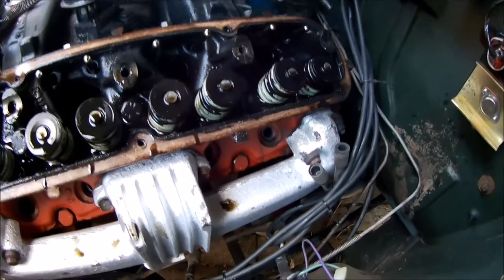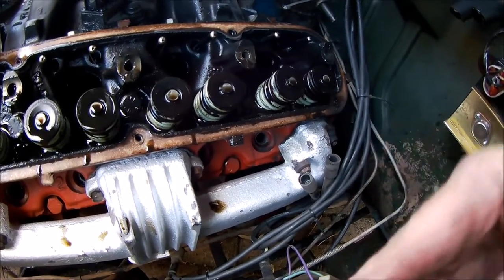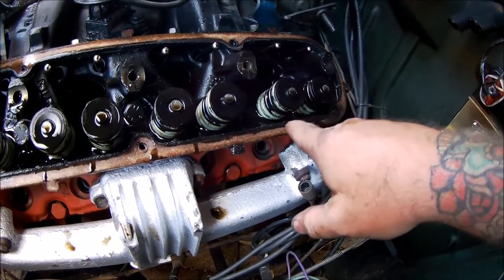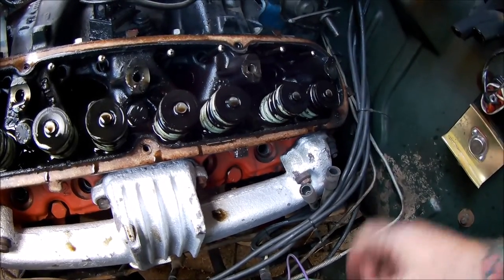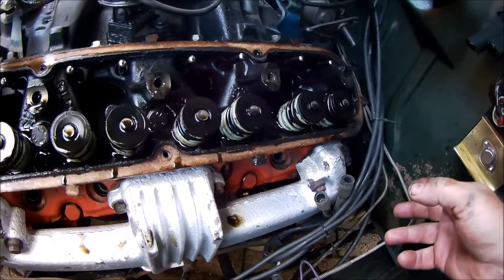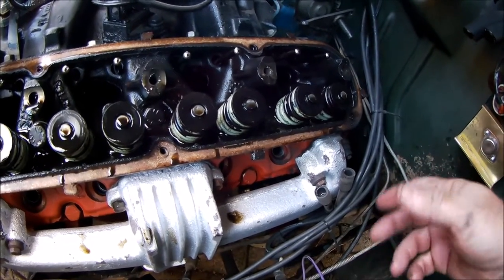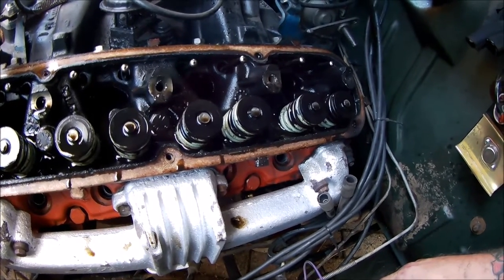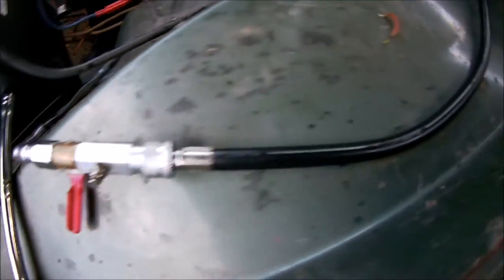Alright, so the way these are done normally is the heads come off, then the valves come out, you redo your valves, you redo your seats, you put new valve seals in there and all the springs back together, put the head back on. But when you've got a good running engine and all you need to do is a valve stem seal, sure this could do with a rebuild, but it's a good running engine, you don't need to pull the thing apart. But you have to have compression, because if you've got no compression this ain't going to work. So what I've got here is a hose